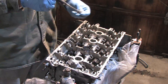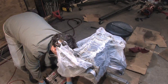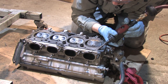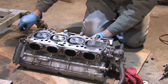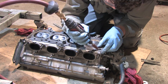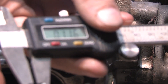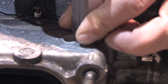While I'm in disassembly mode I thought I'd also take a whack at removing the oil gallery plugs. I managed to get two of them out. Before you start grinding on the head, protect the deck surface using an old head gasket — hold it in place using at least four head bolts. This engine did not have a deep enough teardrop to make a hydraulic valve train work properly, much less have enough oil left over to feed a turbo. I've gone about 15 thousandths deeper than stock to relieve some of the short block pressure.